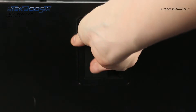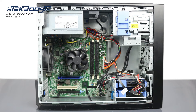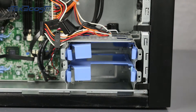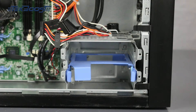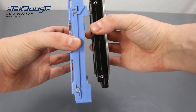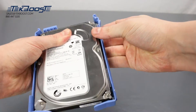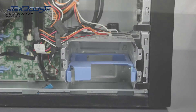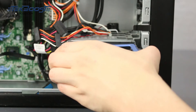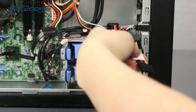To open the workstation, lift the latch found on the side. The hard drive trays are located near the bottom of the system. Remove a tray and place the hard drive inside, ensuring the four pins on the tray line up with the four holes found on the hard drive. Once properly mounted, the hard drive will be flush with the tray and you can reinsert the tray back into the system. Connect the data and power cables to finish the installation.